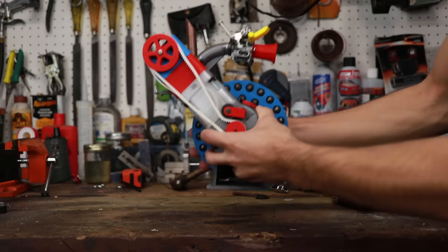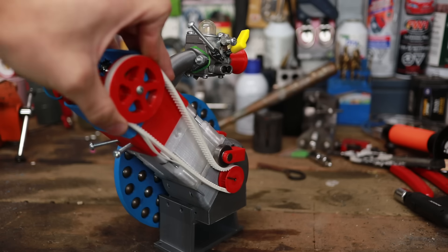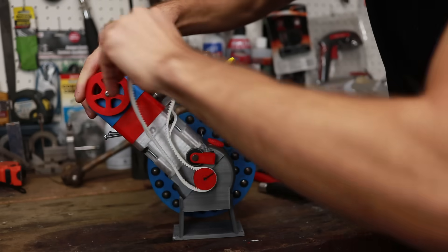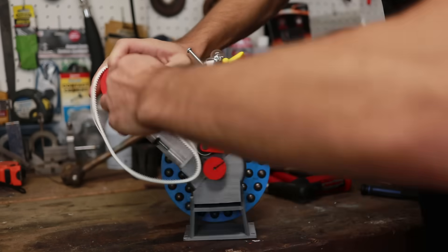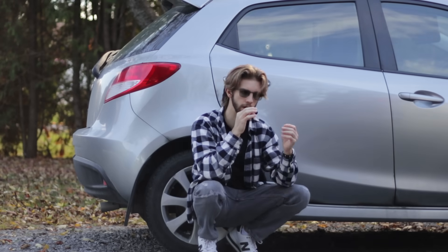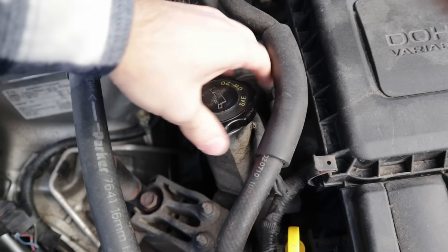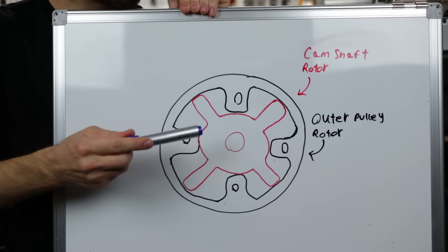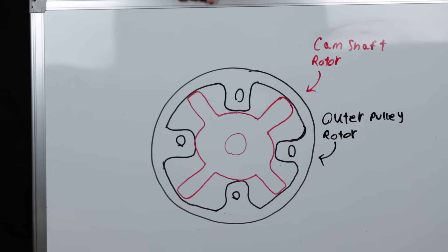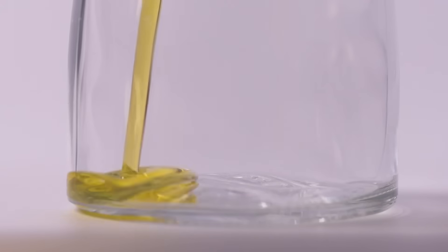Now I think it's time to address the elephant in the room: exactly how am I going to phase the intake timing? On my gas engine, the camshaft is connected to the top pulley, which is in sync with the crank pulley via the timing belt. The only way to change that would be to stop the engine, remove the belt, turn the pulley back a few degrees, and slip the belt back on — which is nothing but a pain. The obvious solution would be to look at modern cars, since ever since the 2000s it's pretty much become standard that everything has VVT. You can actually see it underneath the oil cap. These cam phasers consist of an inner rotor and an outer rotor that the timing belt rotates, so you can turn the inner rotor a few degrees forwards and backwards with oil pressure.